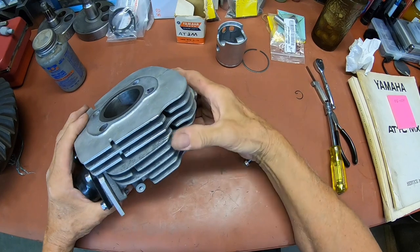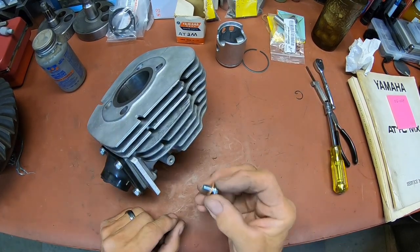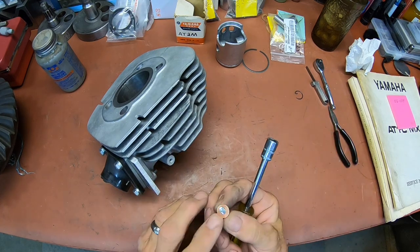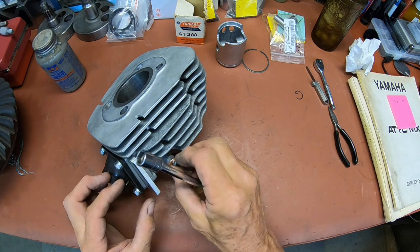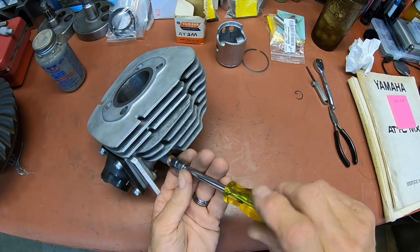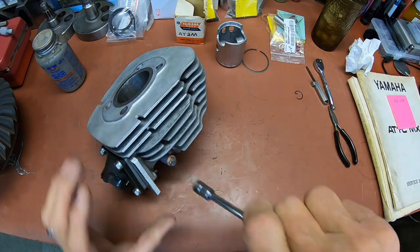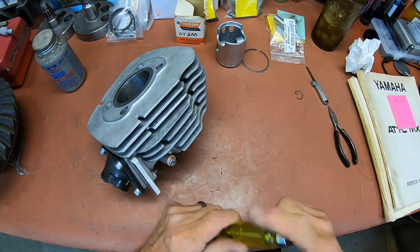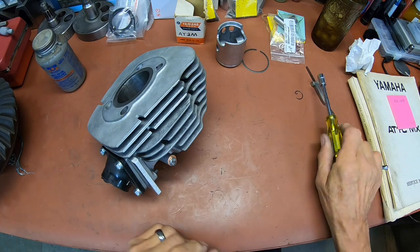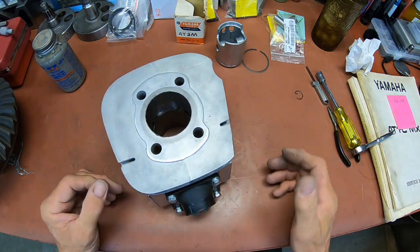Okay, one other thing on this build, this is gonna be a premix. So we're gonna block off our injection port and make sure you put a copper washer or something on there, at least that's going to form fit to that. And it's the same threads as the banjo bolt. Just be careful tightening it up. With the copper, you shouldn't need too much tight.